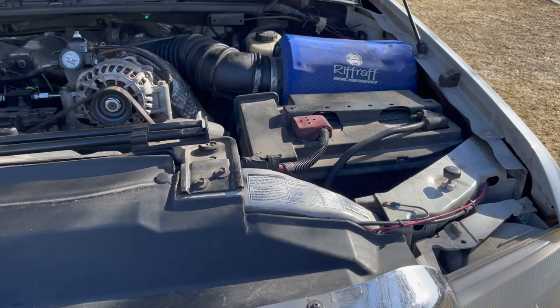There you have it — a detailed walk-around of things to check very thoroughly when buying a truck. The motor is going to be up to you; bring a mechanic friend. My approach when I pull up is I want the vehicle cold, check the oil, check the transmission fluid, check all the fluids, roll underneath and see if it's leaking, listen to what it sounds like, and bring an OBD scanner. I think an Excursion-specific mechanic should make a video to piggyback on this one covering engine-specific things to look for.